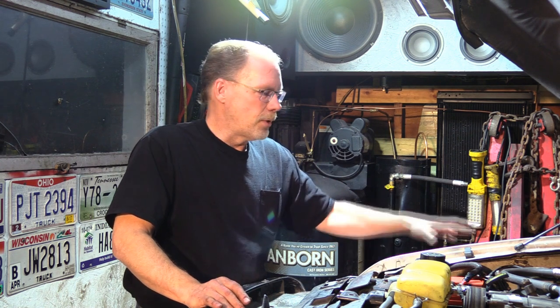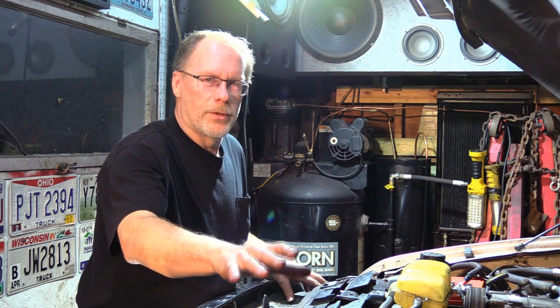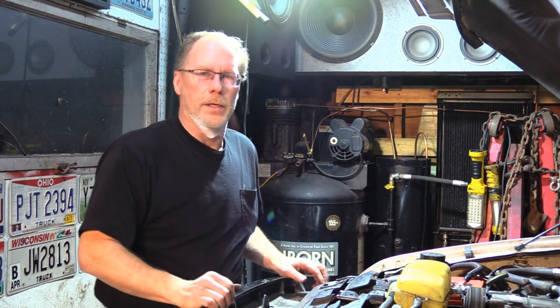And you're going to put a brand new battery in on this side, whether it's the same company or a different company, you're going to have runnability problems, and you're going to have a situation where this battery here, let's say if it was 650 cold cranking amps, is going to gauge at that amperage, but your driver's side might only be 300 or 400 cold cranking amps because it's been in here for several years.